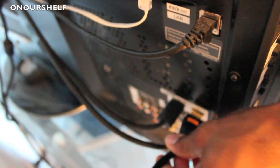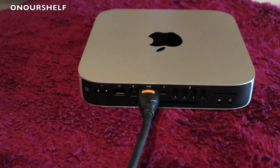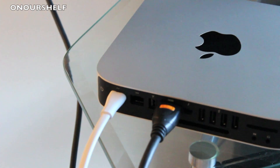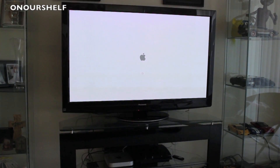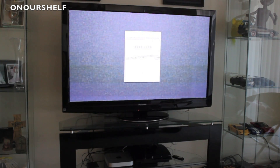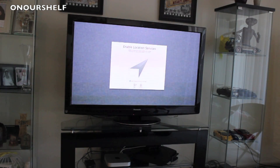To get started, simply plug the HDMI cable into the back of the TV and plug the other end into the back of the Mac Mini. Plug the power cord into the back of the Mac Mini and then into the wall. Press the power button and you're ready for your first boot up. Once you see the Apple logo, it walks you through a series of screens: Bluetooth keyboard and mouse setup, Wi-Fi setup, iCloud, time and date, enable location, and register your computer. Agree to the terms and you'll see the thank-you screen — you're all set.